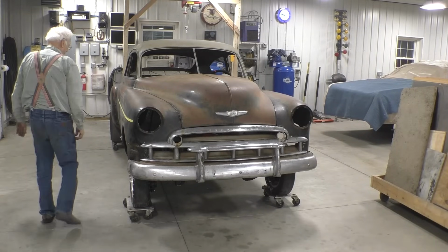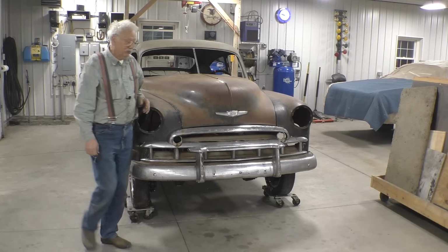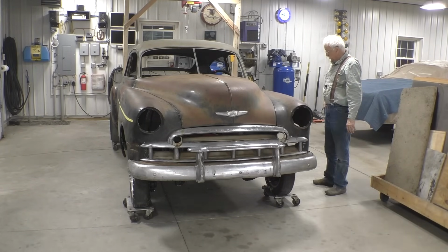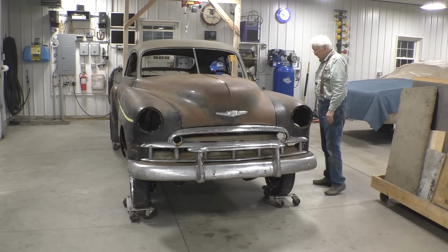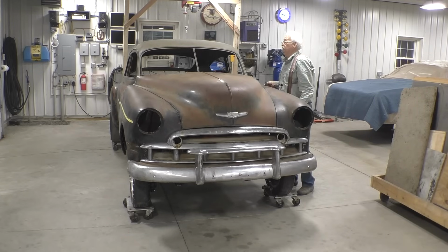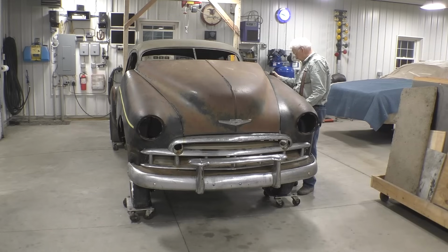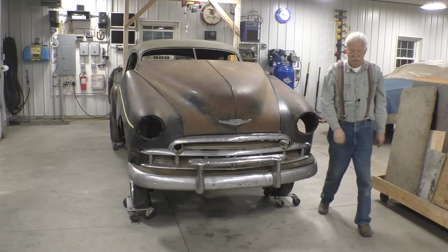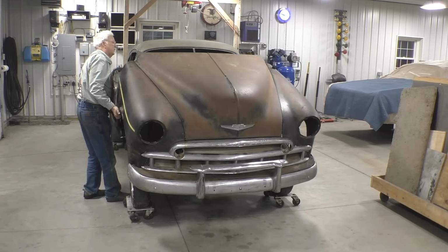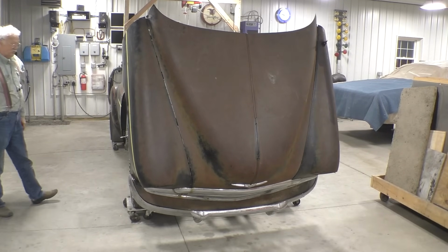The pins have added a complication to raising the hood, but it can still be done by one person. What happens is the pins catch the lower edge of the fender, and that causes the fender not to go up. So what you got to do is walk around and unhook it. So we're going to raise it this far, and it gets caught on the pin over there. And if we raise this, push this fender back in on top of the pin, then we can come over on this side and free it from this pin and raise the hood. And it's the same thing going down.